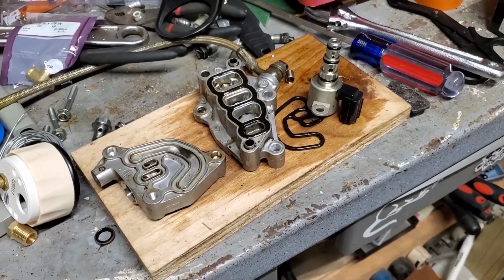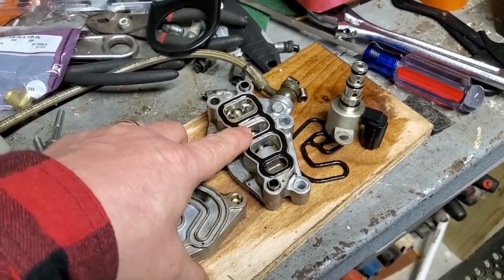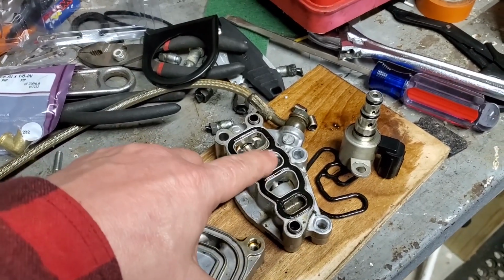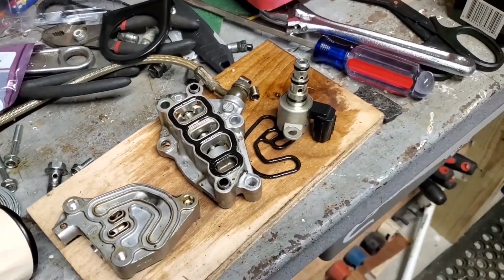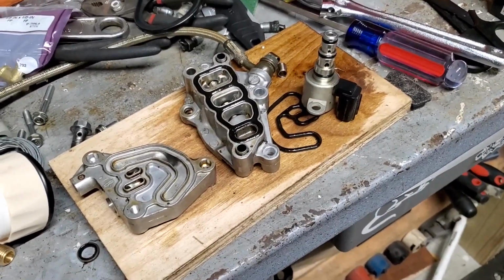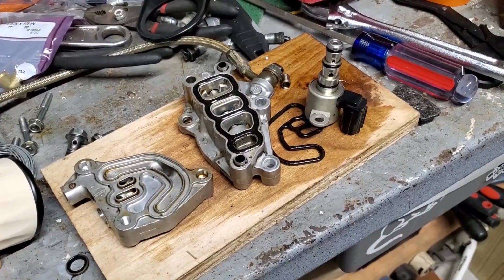But think about it. This 2647 can't be an oil supply problem because it's registering too high, so it can't be that. Maybe the opposite, the 46, possibly that could be, but not a 47, because it's saying it's too high when it's not supposed to be, not too low.